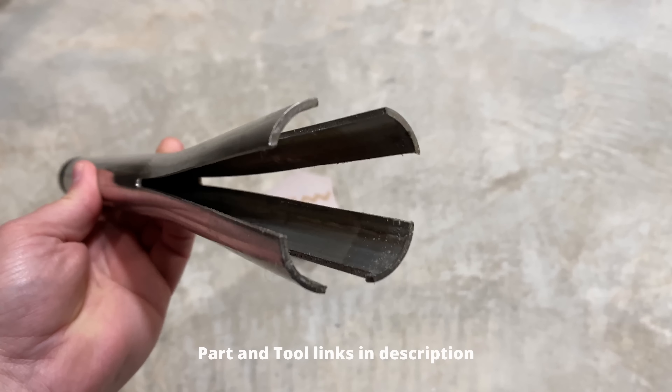I'll also need some grease, and a fork with a tapered steerer, and a tool for setting the crown race on the fork. That's optional with the Funn headset. Crown race tools can be expensive, or they can be super cheap — like this one I made out of PVC pipe from Home Depot: one piece of two-foot pipe section, a coupler, and a cap. That cap is even optional.